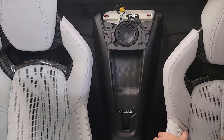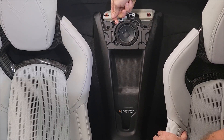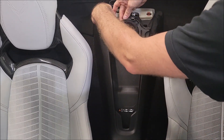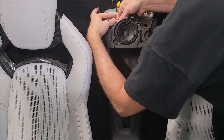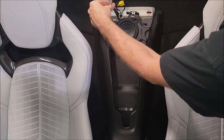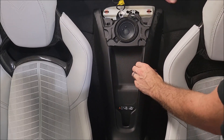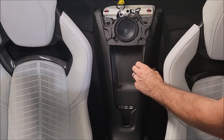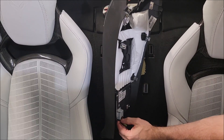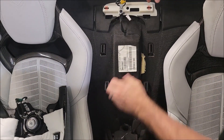Be very careful — this right here is the speaker wire. Pull up the red tab that locks it down and unconnect it before you try yanking this assembly, because there's no slack. Pull the connector off for the speaker first, because when you yank the panel it releases all the clips at once. There's also a bungee cord to be careful of. Then pull it back and at the bottom disconnect the wireless Bluetooth charger too. Now you've got this panel loose — flip it open.